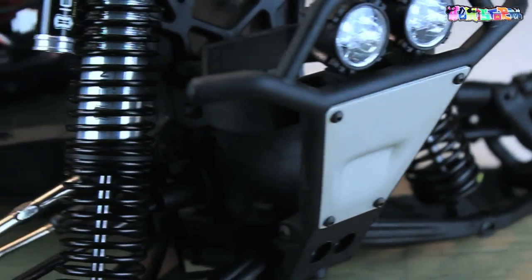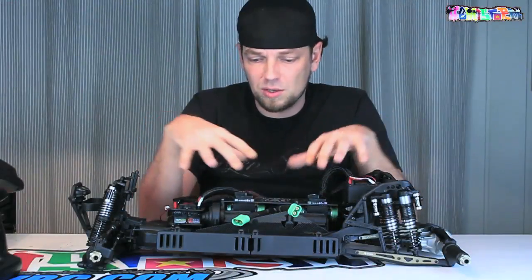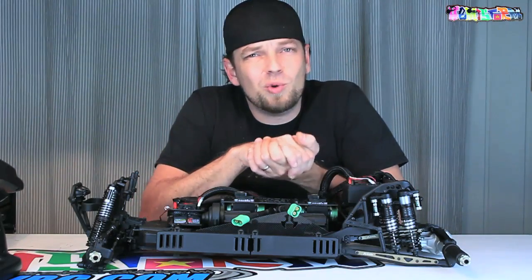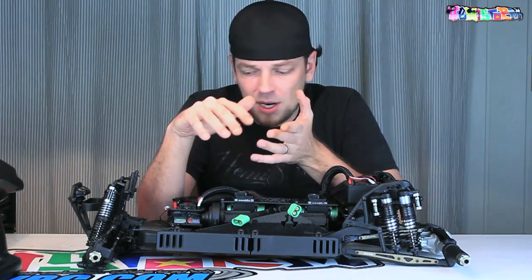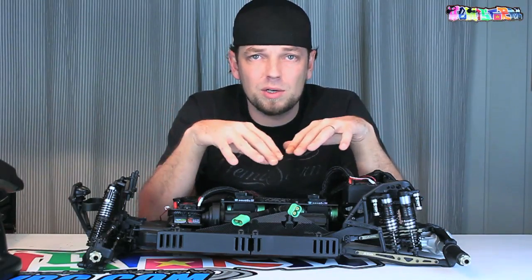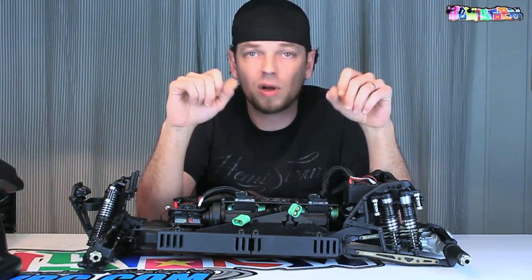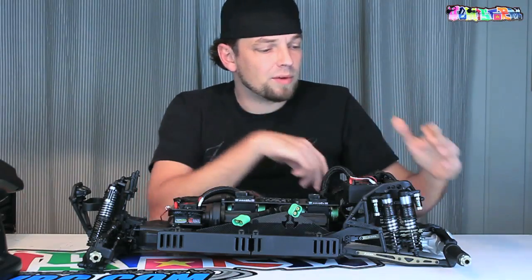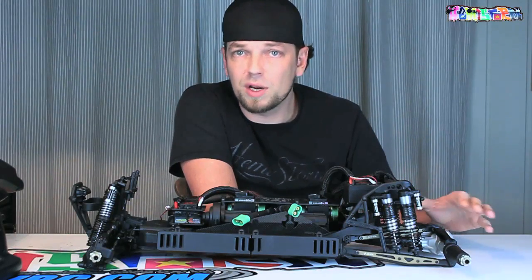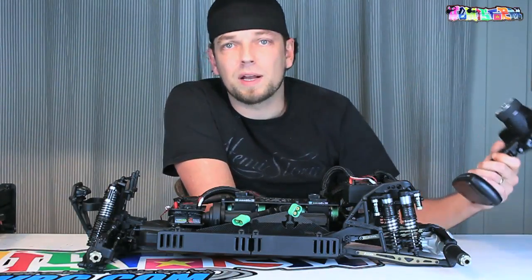The front transmission case is just going to power the front and the rear transmission case is just going to power the rear. You can do this in several different ways. I chose to do it like this just because I want to have a dig set up on this car. If you are running two ESCs in one car, you can use a regular Y-splitter on your second channel, which means that you evenly distribute the power to one ESC and to the other ESC — they both get the same input signal. What I want to do, however, is be able to disengage the rear or disengage the front, or overdrive or underdrive the rear or the front, and I want to be able to do all that just by using my radio on the fly.